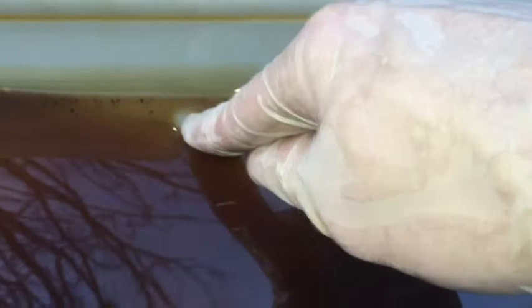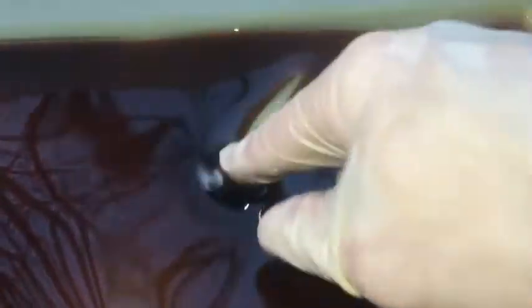Here's a look at that old lubricant. I've drained off most of it so we've just got the bottom. I don't see any metal shavings — that's a good sign. It doesn't look that bad really. We're talking 70,000 miles without changing this — maybe even more than that. So this stuff has held up really well. I don't remember what was put in here, but it's pretty dirty, though not that bad really.